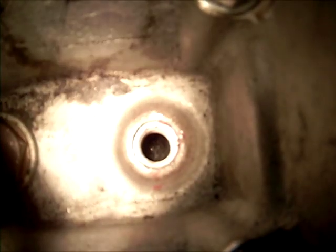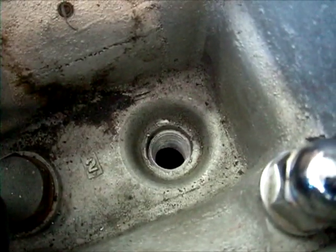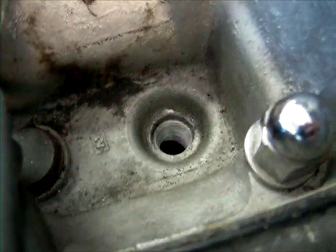I'm actually looking inside with a flashlight. I'm going to continue cleaning it out until it's completely clean and I don't get any more globs. I've spent about an hour cleaning the hole - a lot of stuff in there. I'm down to the point where all that's coming in is a little bit of carbon on top of the piston. I've gone ahead and cleaned out the threads to get the grease out. They recommend brake cleaner, but I used lacquer thinner with paper towels as the degreaser - that should be fine. They just want you to get the grease out so that the Loctite will work.